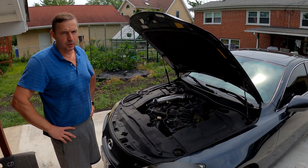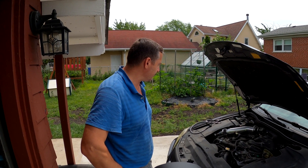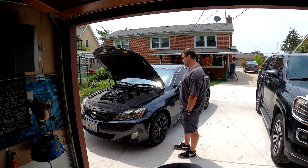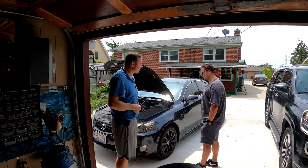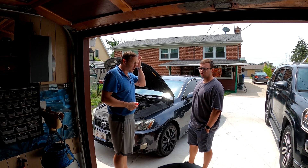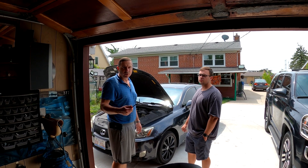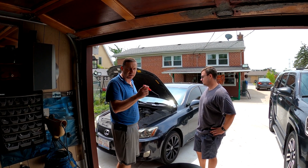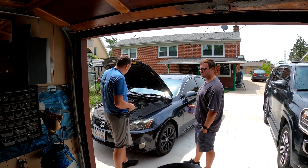Otherwise it's three to five thousand dollars to replace the engine, or go buy a new car — with prices up like $20 grand, it's not worth it. He was driving on Lakeshore Drive, about 50 miles an hour, and the check engine light started flashing. He gave it gas to the floor — no power at all. That means that cylinder already quit, lost compression completely, so he was driving on five cylinders and then came back in the tow truck.